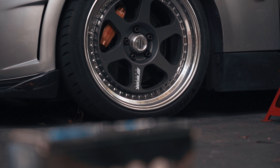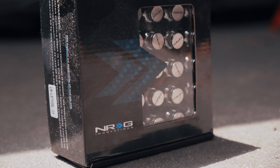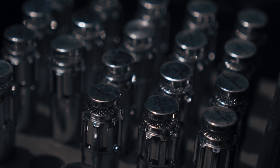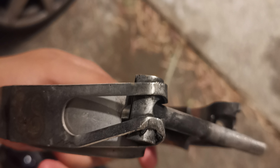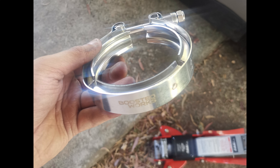Hey guys, back again. Today we're going to change out the wheel nuts because the Mishimoto ones are aluminium and using the gun on them, I absolutely stripped them to death. We're also going to change out the front lower control arm bushings because as you can see here, it's kind of coming off. Also, I had the V-bands on my exhaust pointed down where the nuts were facing the road. We went for a cruise and they got scraped and one of my V-bands came off and my exhaust was hanging. So I've got some new ones and we'll put them in as well.